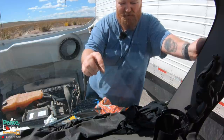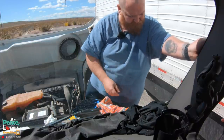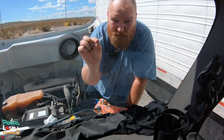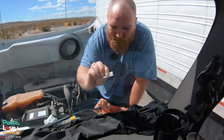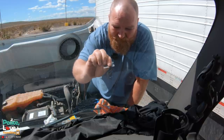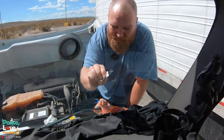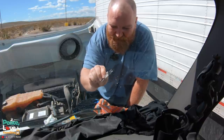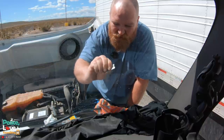All right, we got our second curing strip on. I'm going to go ahead and peel this curing strip off. Then you take your razor blade and put it at a 45-degree angle, and you've got to clean off any extra resin. It sounds like a freaking chalkboard.